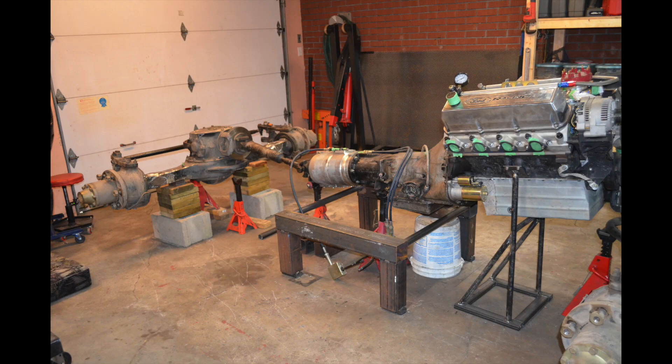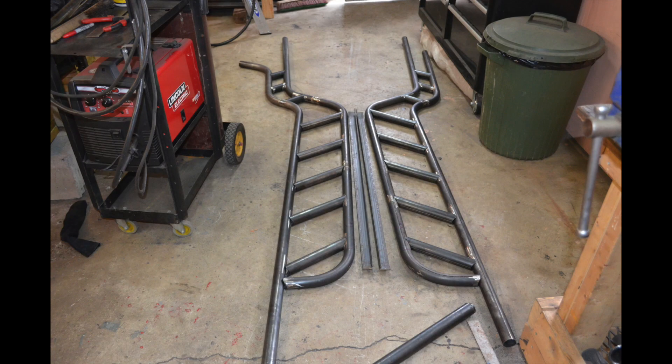Now that I know exactly how much link length I want, I can approximate where I'm going to start building the bends in the frame — looking at the chassis table — and this is exactly why I was doing this video today. The subframe of the chassis is one of the most important structural pieces of the buggy and will take a tremendous amount of abuse. Anywhere you're going to mount a suspension link, I overbuilt it: I put 3/8 flat bar, added gussets and braces, and made sure to fully weld everything. I've seen cracks start in the frame around those areas, so you have to build it as strong as possible.